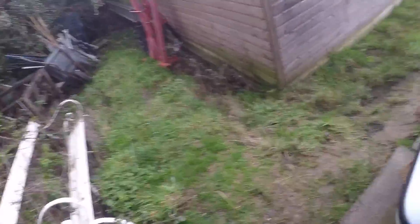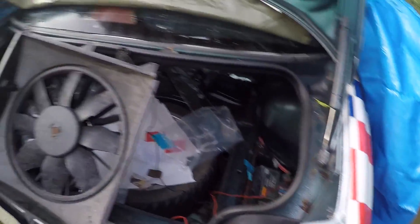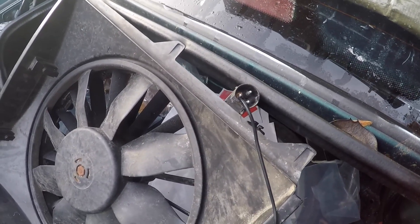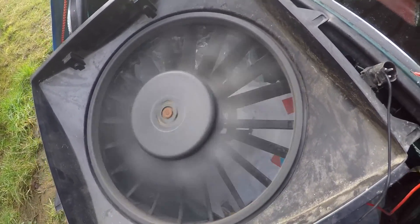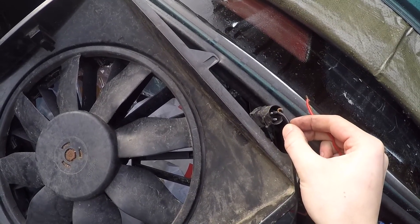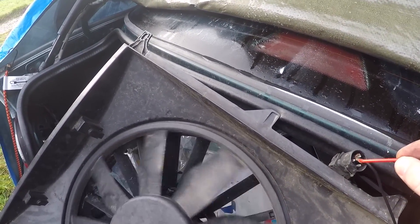What I do have is, on my 318is — because it had air conditioning and some funky setup — it didn't have a clutch fan. I don't think the four cylinders have clutch fans. So I've wired it up to the battery just to check it still works. It's got three points — one's a signal for when it knows to turn on, and the other two are just positive and negative. It still spins quite well, and as you can see it's spinning this way. But you can reverse the polarity if you want it to suck, because that's what I think I want this one to do. Now it should come this way — and it does. That's quite cool.